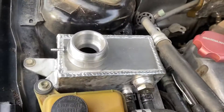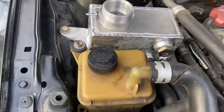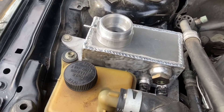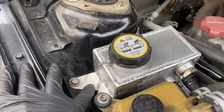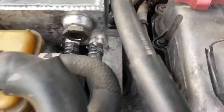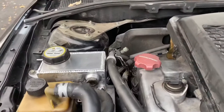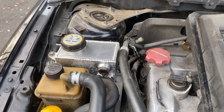I'm probably going to end up heating up this bracket and bending it so it sits straight. I did end up bending this tab up right here — not only for the OCD factor, but also because the way it was leaning it was sitting on top of the motor mount and vibrating, and I didn't want that causing a crack. So I heated it up and bent it straight. Other than that, it seems like a pretty nice piece. I'm going to fill it up and check for leaks, and if there's no leaks we're good. Really simple install: two bolts, three hoses, fill it and bleed it, and you're good to go.